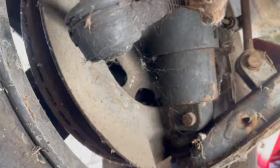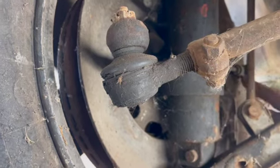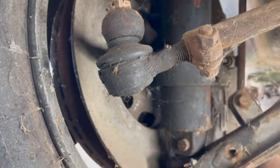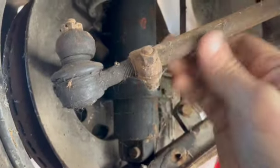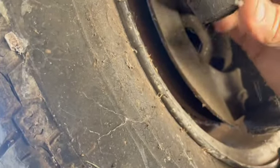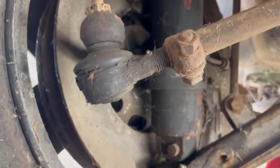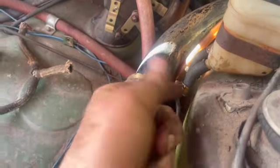Doing a little video today, getting up underneath the 911. Going to start on brakes, putting in a master cylinder. This is a 911E — 911Es and S's had aluminum brake calipers, the T's did not. Wanted to definitely document all the before and after, and the extent of the detail and cleanup. The tie rod ends actually look pretty good. We're going to start working on the brakes today.